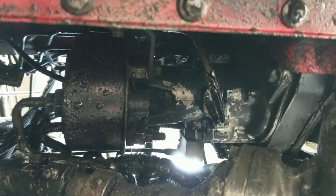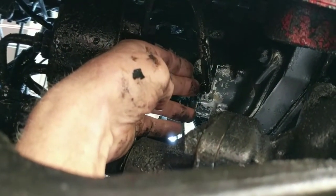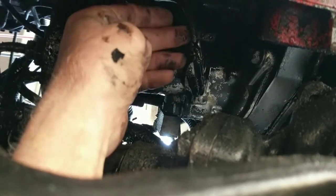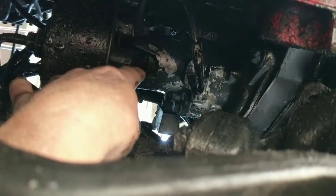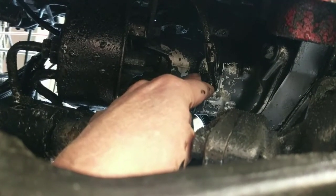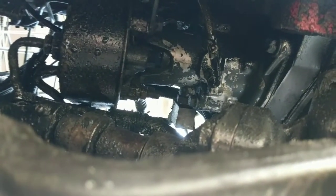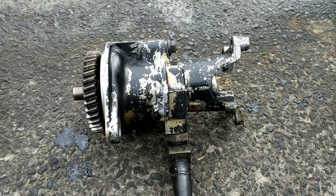The easier method: take the four bolts out of the power steering pump, push the power steering pump back out of the way, and then take the vacuum pump off. The vacuum pump has an oil feed line right here that you have to remove first — that's what causes the bad leak since it supplies pressurized oil inside. Remove that line, put something underneath to catch the drips, then take the two bolts off the vacuum pump — one on top, one on bottom — and it should come right out.